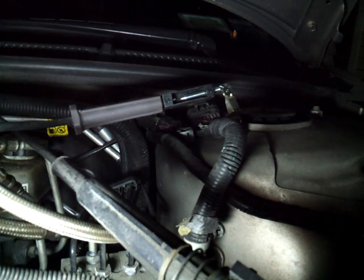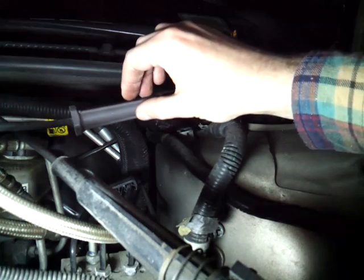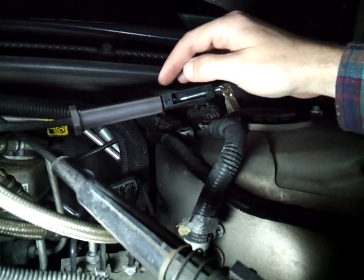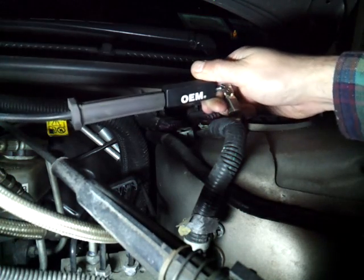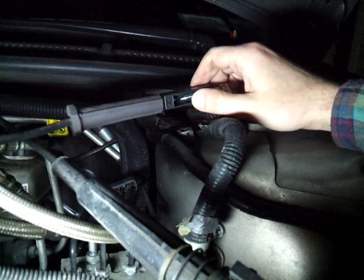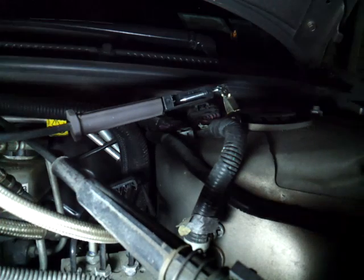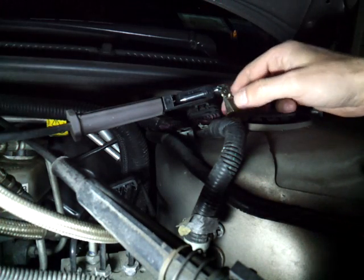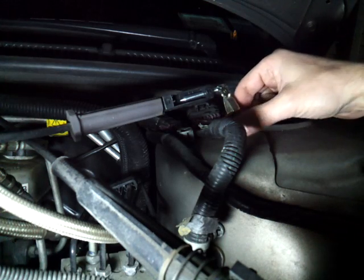In this video I'll show you how to check for ignition spark on your car. This is an OEM tool — I took the ignition wire off the spark plug and hooked it up to this tool. OEM makes this and it's a nice tool because you can actually widen the gap for the spark to jump, to see if it's a strong enough spark or too weak to make the jump.